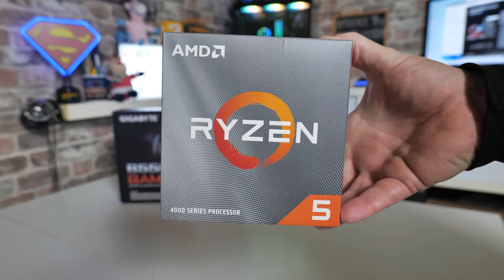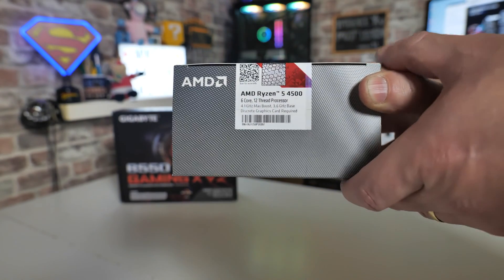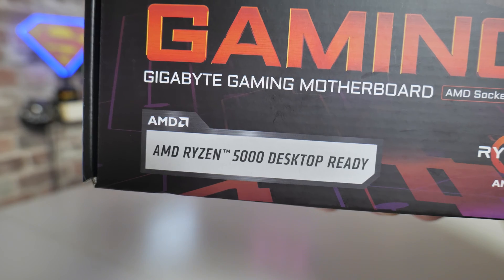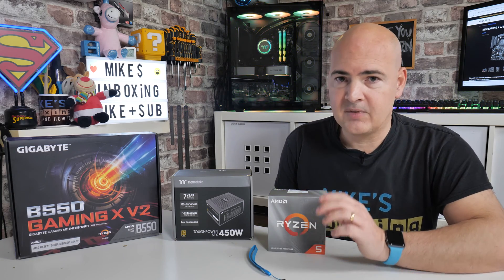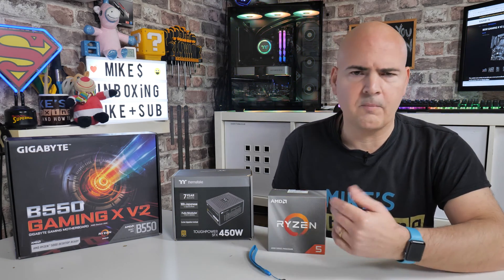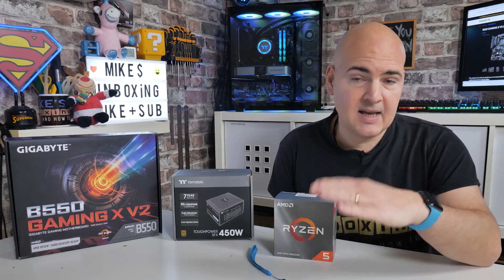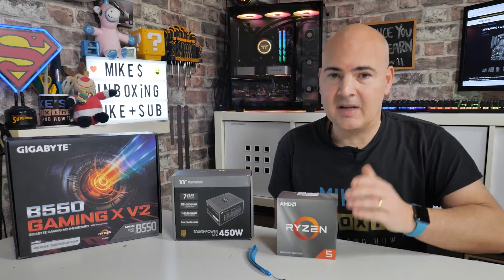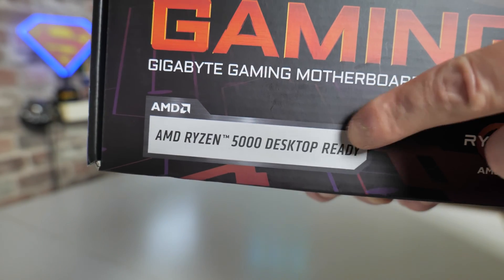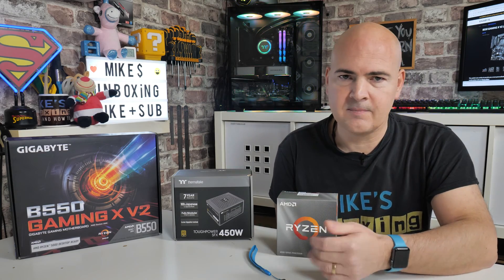This processor is here for a very good reason — this is something a little misleading from the packaging. The box says 'Ryzen 5000 series ready,' which is excellent, but it doesn't confirm which BIOS version is on the board. The BIOS version covering the 5000 series isn't always new enough to cover even slightly older processors. This is the Ryzen 5 4500, which came out after the initial 5000 series launch. There's also no sticker for Ryzen 5600G or G series compatibility, so the best thing to do before you get started is to do a BIOS flash.